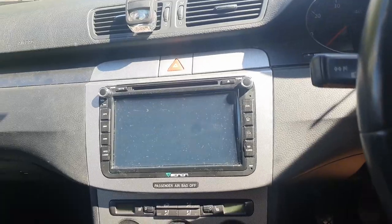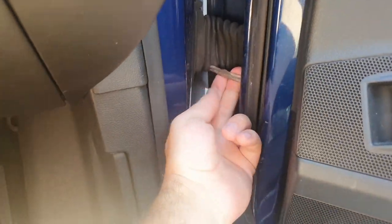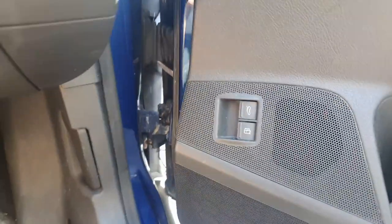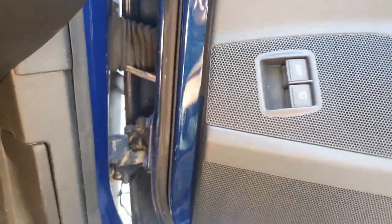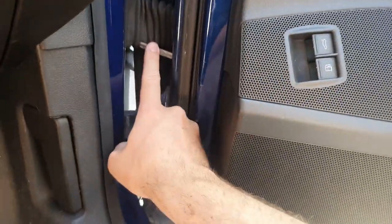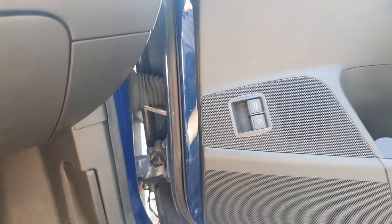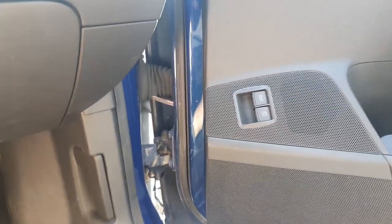Another thing — if you open the door, the wires here that go to my speaker, every time you're opening and closing the door those wires become brittle and sort of lose their connection. You could try opening and closing the door and if the speaker works then doesn't work, works then doesn't work, it might have a bad connection in the hinge area of the door. So that's another thing to look out for.